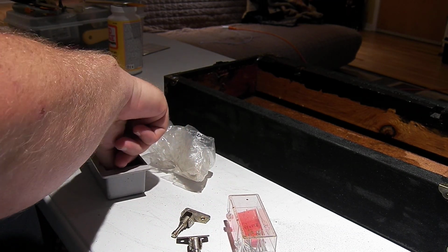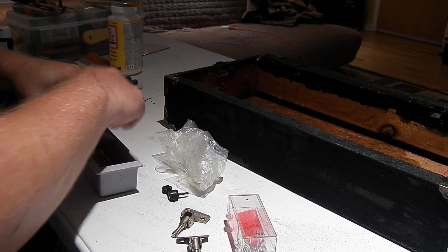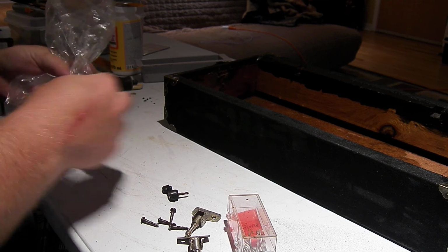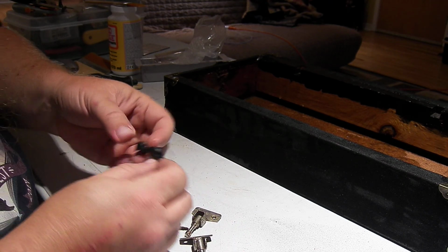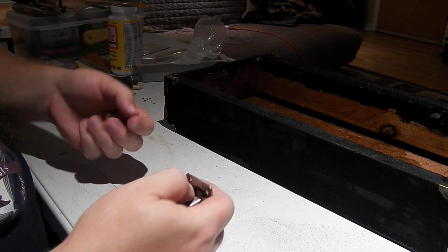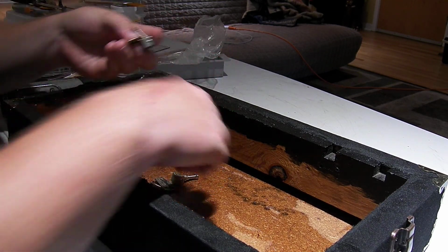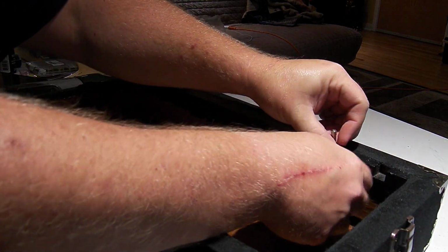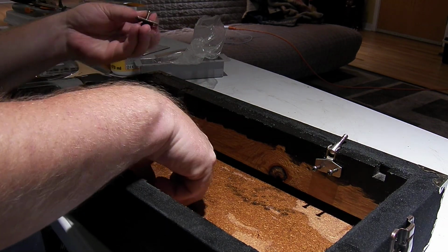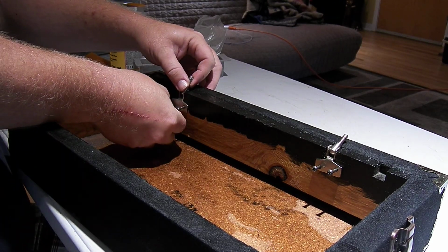the two hinges that support the machine and the 4 screws. And then this is the latch from the front of the case that holds the machine down a little bit. So, start with these hinges. And because these are going right back in the same hole, I can thread the screws in by hand for a minute, and they will set in there.